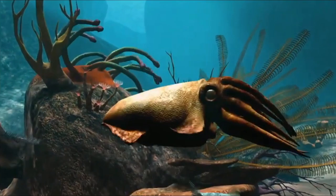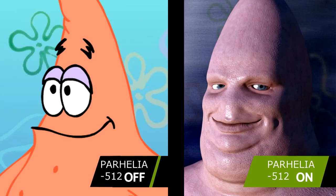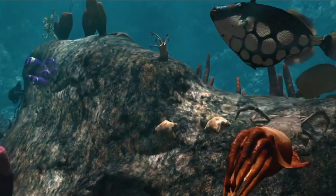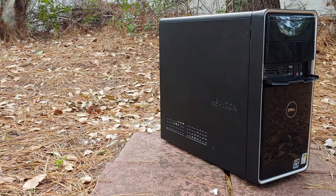Compared to its predecessor of just four years earlier, the Parhelia APVE seems to be a direct downgrade, and in many ways it is. The APVE did not come in a 256 MB flavor unlike some AGP or PCI-X Parhelias, and also has a heavily cut-down version of the GPU compared to its predecessor. The only advantages it seems to have out-of-the-box are the PCI-E support and a slightly higher core clock. We'll have to see if we can do something to close the gap a little bit sometime later.